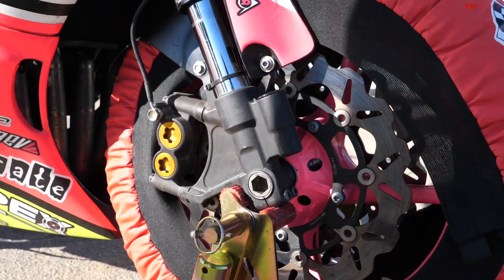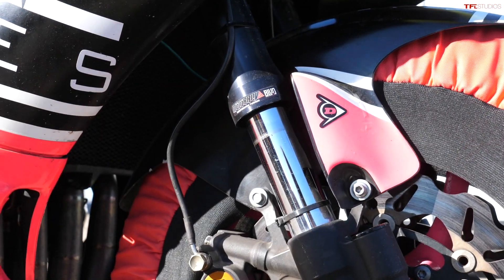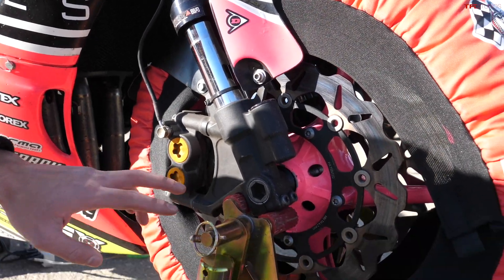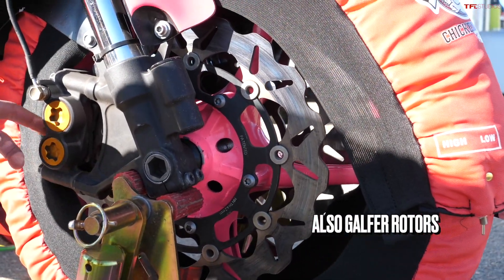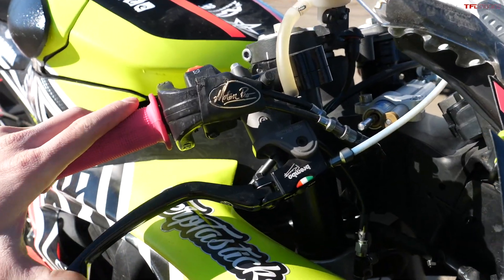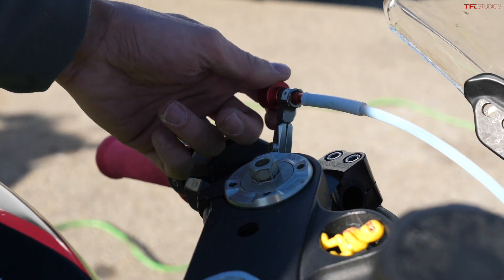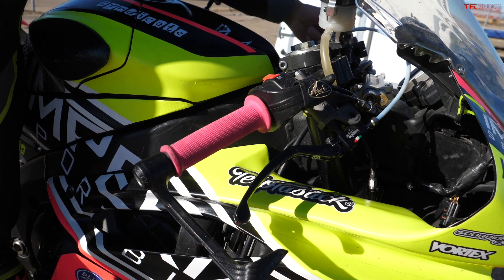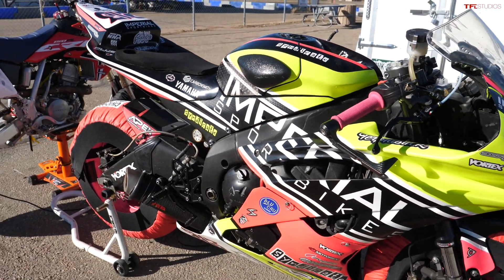Let's talk about suspension and brakes on this bike. Suspension has been done by Motorev — they are a professional suspension tuner. So fully adjustable front forks and really, really solid suspension. For brakes, stock calipers with steel braided lines. I've got some nice sintered road racing pads in the front that don't last all too long. Up top, Brembo master cylinder right there, so nice pull on that. And then you can see this tube coming out here — there's a little adjuster for the distance on the brake lever. If you look here at the brake lever while I spin that, it'll actually adjust the distance, so you can dial in and adjust the brake lever pull for certain parts of the track, and you can do that every lap. Pretty cool setup there.